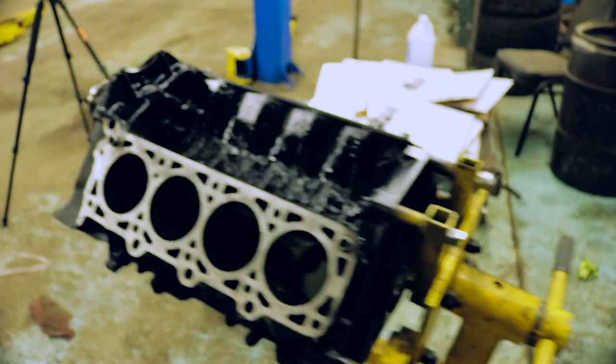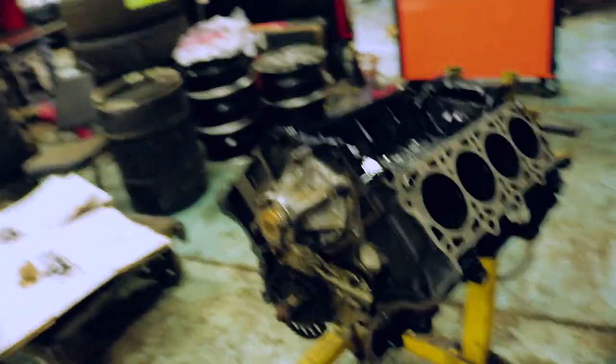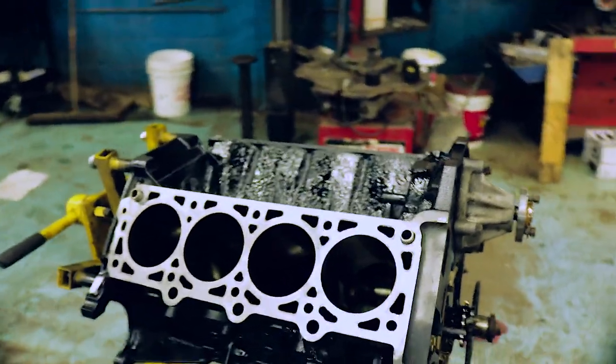With the cams, I'm going to need these crank gears here. With aftermarket cams you need to adjust the timing — your centerline. They're not all made the same for some unknown reason. You need to degree your camshafts, and by doing that you'll get rid of valve clearance issues. That is a big thing that I don't know how to do, but I'm going to either figure out how to do it or pay somebody to do it because I want it to be right. I've done timing chains on multiple things, but degreeing cams is a whole other ball game because it's basically all math. I'm actually real pumped with how this is coming out — it looks pretty damn good.